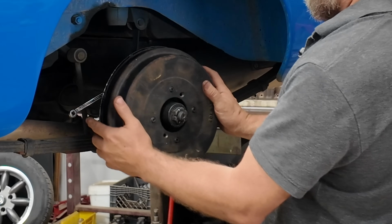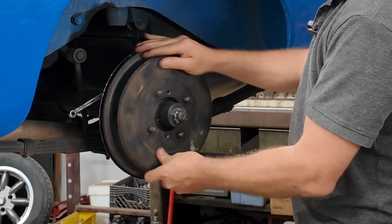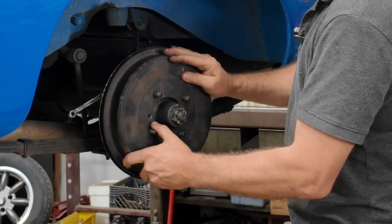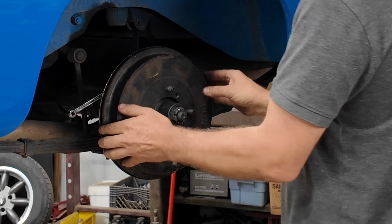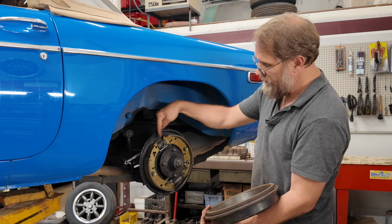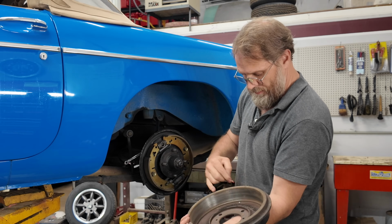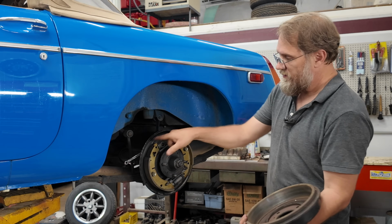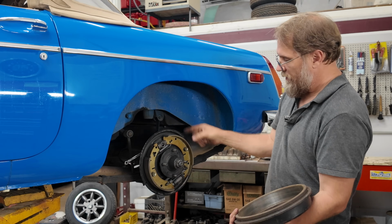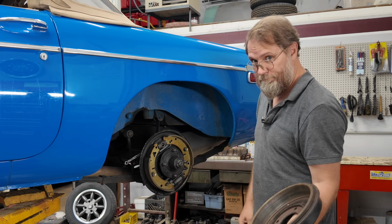But you put this brake drum on here and see it's really loose right here. But then you turn it and it gets tight. And then it loosens up again. Well, that is because the short measurement is across here right now. Now we know where that is. It's going to be roughly right there and there. So we know that's probably the short measurement. So when it's there, it's free. When that gets over here, it's tight. Let's go over there and we'll measure these things and show you.